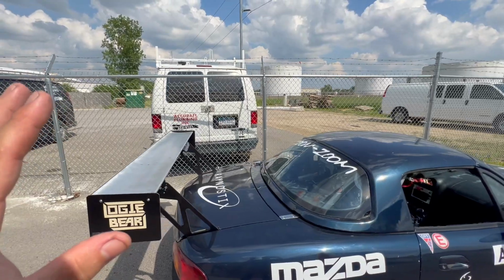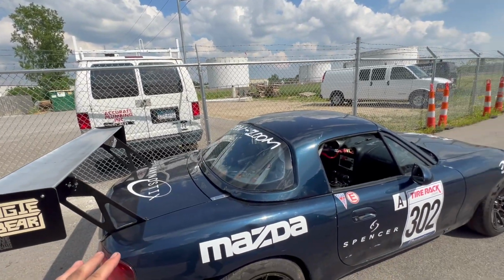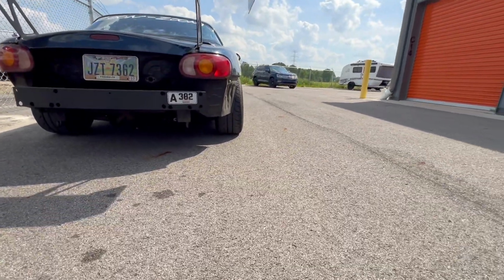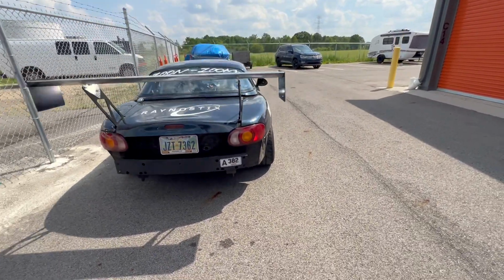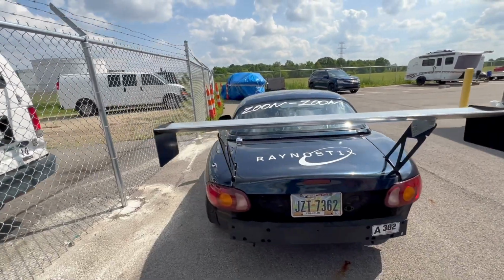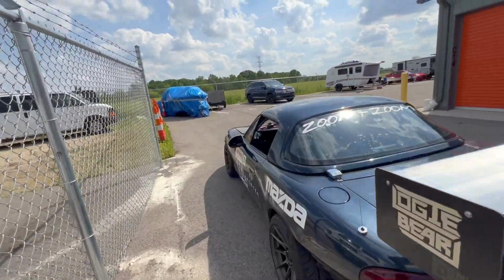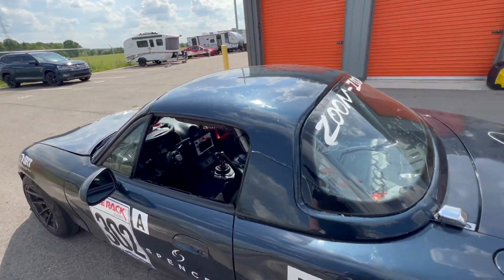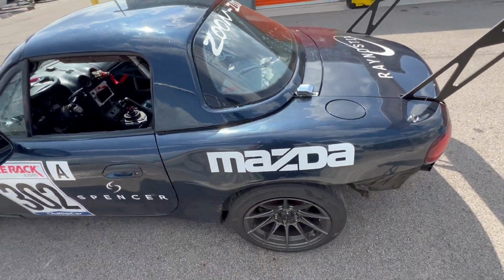I think that's it on the outside. You can kind of see the meaty tires in the back there. We can go up to 245s, which I might do once we get through these tires, just to try them out. But I went 225s for the time being because I knew I wouldn't have to roll or pull any fenders or do anything nuts.